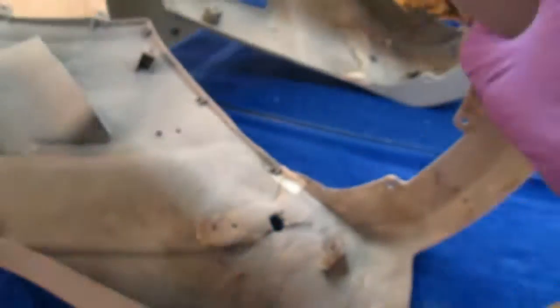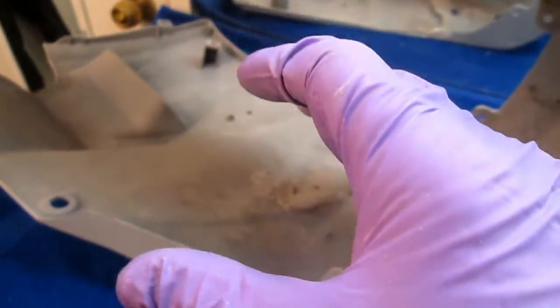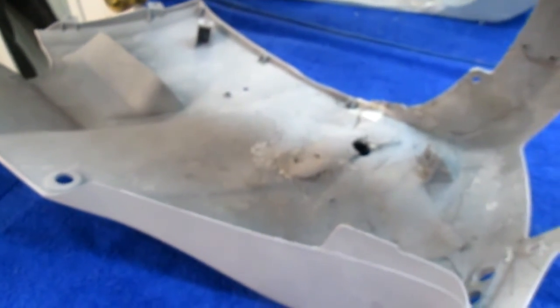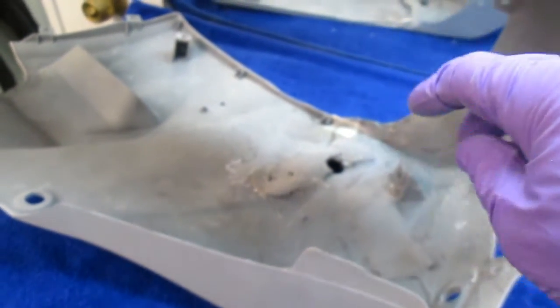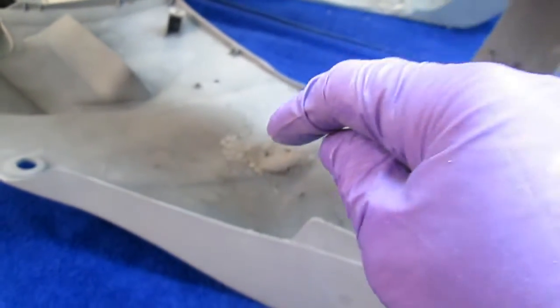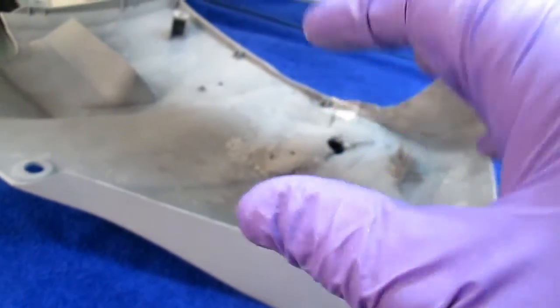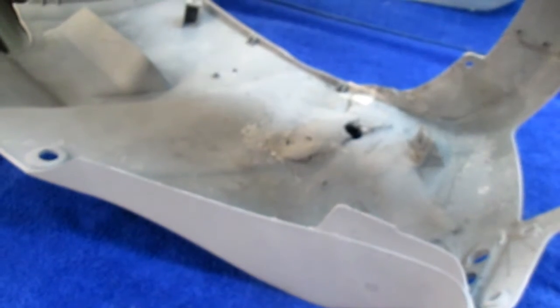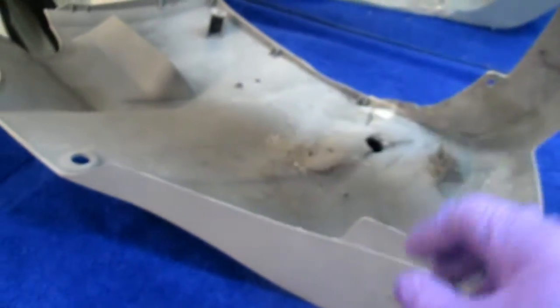And as it goes over the table, if you don't do this now, and you put all this time, and this is going to be a tremendous amount of work to get this all nice and pretty and painted and everything, and clear and whatever, and then it cracks, you're dead. It's like building a foundation of a house. You got to do this part, the structural part first, and then the cosmetic part of sanding and doing all the paint and the priming and everything. It's an important concept. Structural first, cosmetic second.